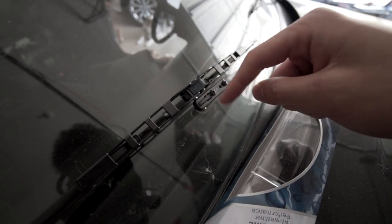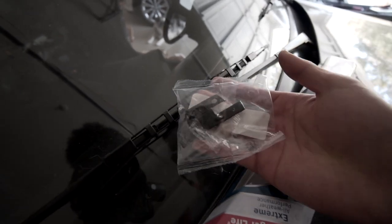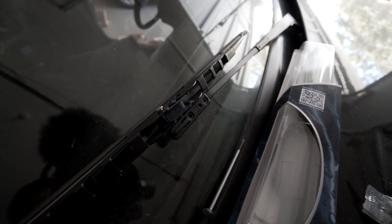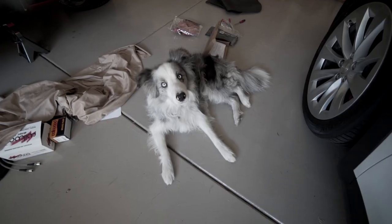To install the new wipers, these Bosch Icons use a hook-type clamp, but on these older cars they have a pin-type clamp mechanism that won't work with the Bosch ones. To fix that, I got these J-hook adapters — you basically unscrew the original pin clamp and install this one on, and that should adapt right onto the Bosch wipers. One of the screws was so stripped that I couldn't get a screwdriver on it, but the Knipex Cobra pliers came in and saved the day. Bosch Icons installed — pretty nice to have modern wipers on an old car. I went with 17-inch blades on the passenger side and 19-inch on the driver's side.